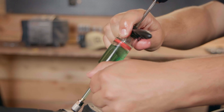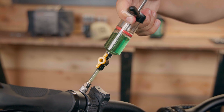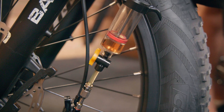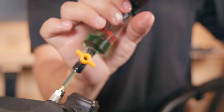Now you're going to open the valves on both of your syringes. With both valves open, you're going to push down on the plunger of the top syringe that is located on the handlebars. The purpose of pushing down on the plunger is to make sure that there are no air bubbles inside of your brake system — this will get rid of the softness that is inside of your brake handles. Once you see that there are no air bubbles in your braking system, you're going to shut both valves on your syringes. If you don't shut the valve on the top syringe, all of your brake fluid is going to run out of the bottom of your braking system, so make sure it's shut.